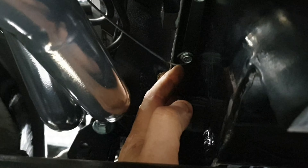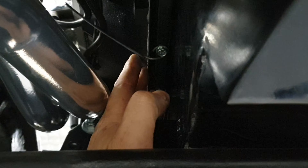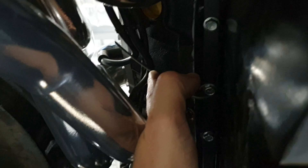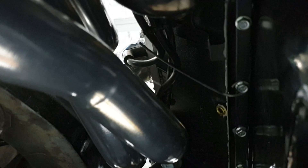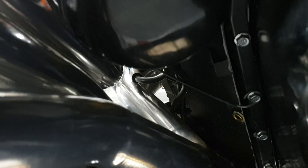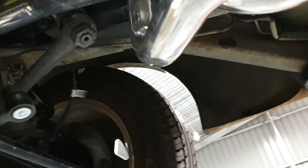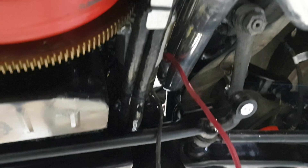I've got a bit of stainless, very high tensile wire, and I coated it in heat shrink. I've just bolted it on there and it pushes up and pulls the plug wires away from the extractors — that's all it has to do. Works well. So now I'm up to fitting a battery in the boot and running some wires.